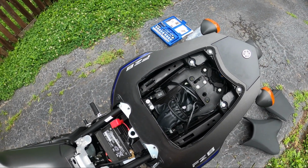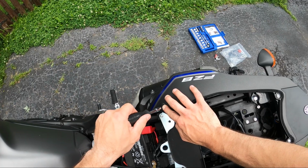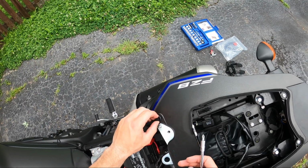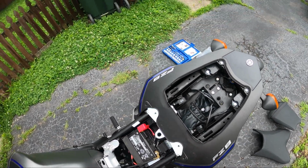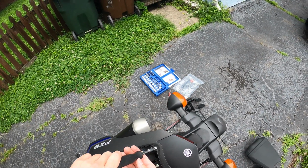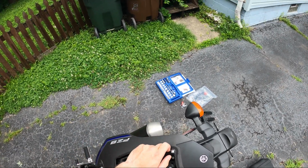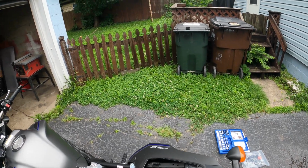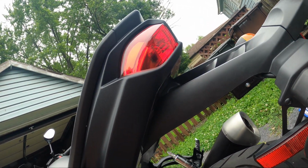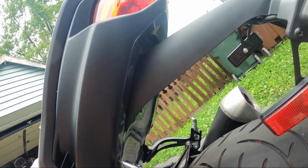So these little pop rivets, you just loosen out like that. And there's that one. Then we can pull those out. I'm going to set these off to the side. Then you have these 2 Phillips heads at the back end of this entire rear cowl. All right, and then after those are removed, you just have, I believe, 6 push rivets all along here. Those would need to be removed. To get the rest of this off, just push the center in on each of these, like so.